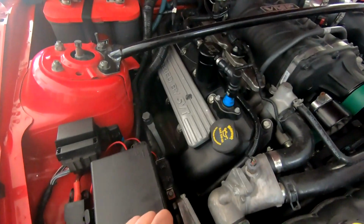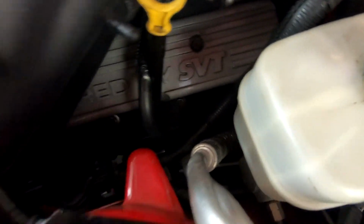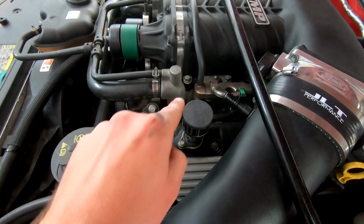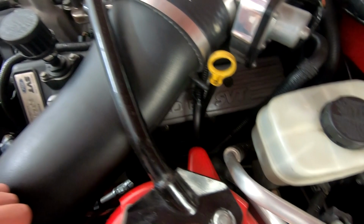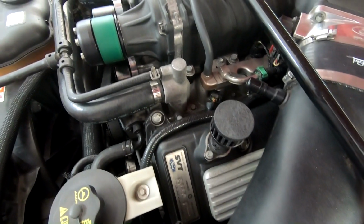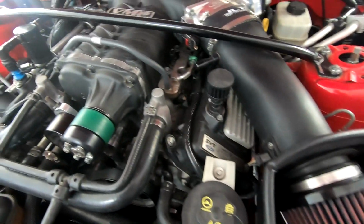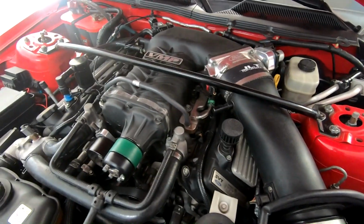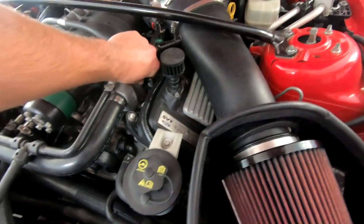All right, that was weird. I swear this front header was glowing a little red. Whatever goes right to this cylinder. So, a lot of heat. That's not good. I don't know what the hell happened there. We'll diagnose it. You're gonna have to pull the spark plug, check that out. What the actual crap is going on with that? Very weird. Usually that happens when there's too much heat from running lean. Couldn't imagine why just that cylinder would be running lean.